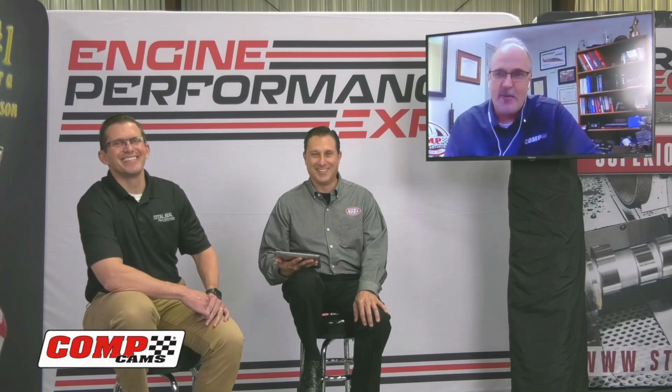Yeah, you think about these valve timing setups, and John had done something on the cylinder head, and it flowed less air. And I think when it flowed less air, he said, okay, we'll do this and this. Let's just move this intake closing in like 20 degrees. And I'm like, John, are you sure? Oh yeah, let's try that. And I got the call back, and John was just so impressed with himself. And I'm like, what are you so happy about? He's like, Billy, I lost 300 horsepower. I didn't know you could lose 300 horsepower.